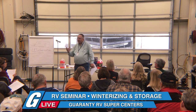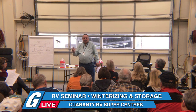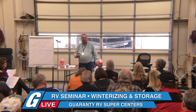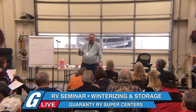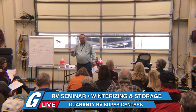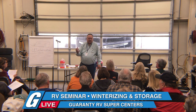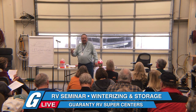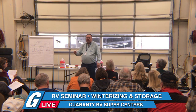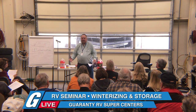What Happy Camper is, is an enzyme. It's a biological chemical, and it eats beta cellulose and organic tissue. It's like me going to prime rib. That's what it likes. So if you have a problem with your probes, you put half of one of those $10 little buckets of Happy Camper down it and fill it about three-quarters with water. And then slosh it around a little bit. What we do is we get the forklift driver to drive it around the shop a couple times and then let it sit for an hour.